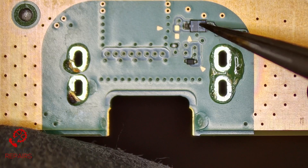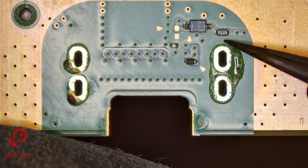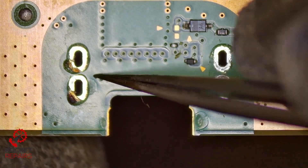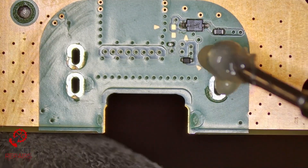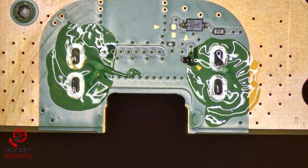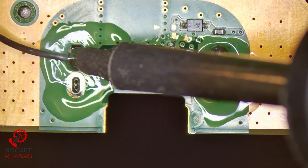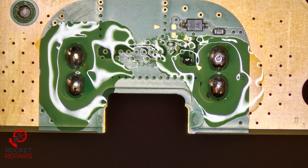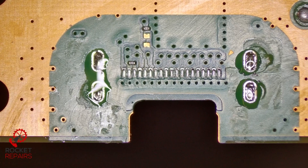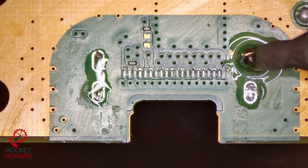Here's the circuit that I was talking about — this is usually on the other side. We still have a smaller diode and a cap here, but you're seeing here we've got the resistor and the diode on this side now instead. This is factory flux. Whilst we're here on the back, I'm just going to add some flux to these ground holes just here and add leaded solder into them so we can get ready to drop the port on. Some of that flux has flown through the holes, so I'm just going to add some more solder on this side.